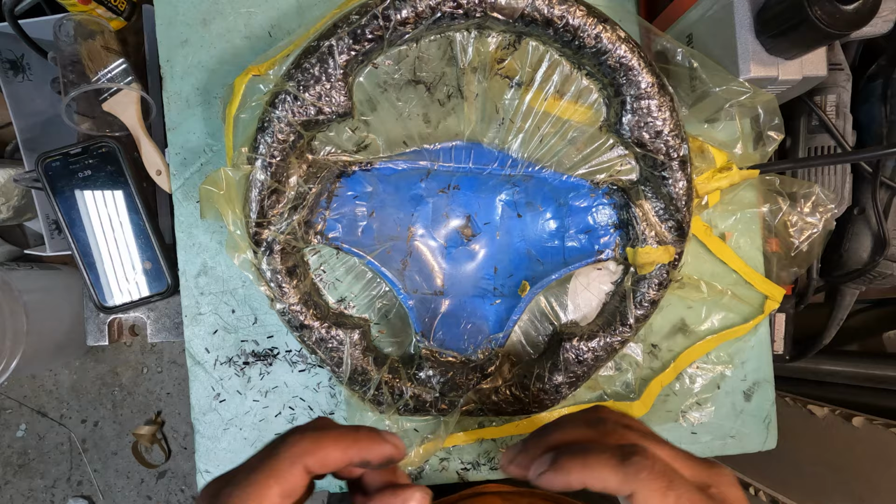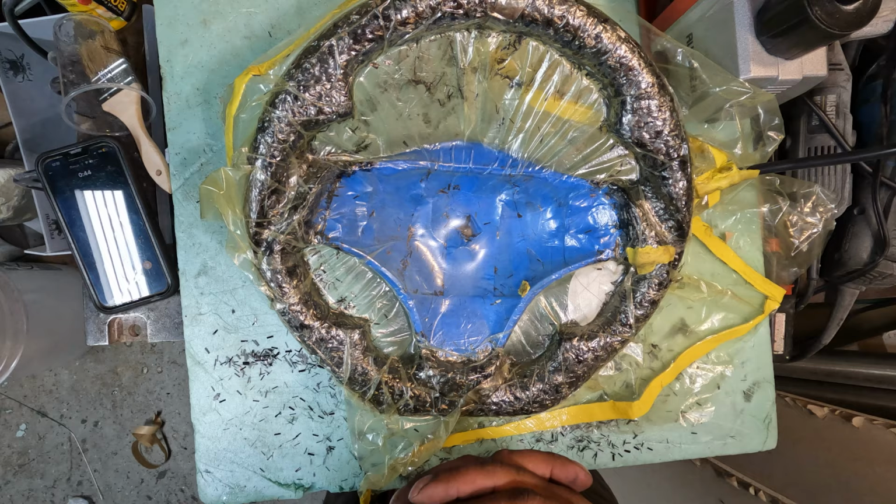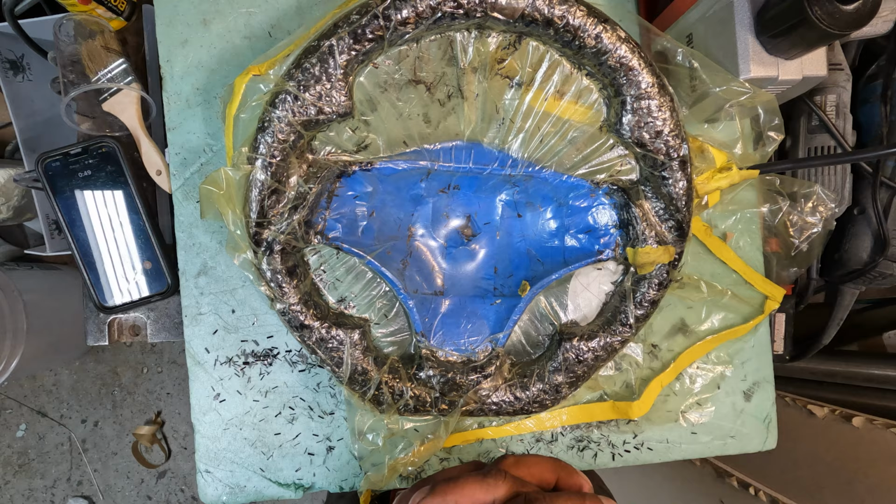Like I said before, you'll get your base layer, you'll cover up as much as you can, and then you're always gonna have spots that are missing because of the nature of forged carbon, you can't get every spot. So that's the point of going with a round two with forged carbon. So again, we're gonna let this cure for 24 hours.